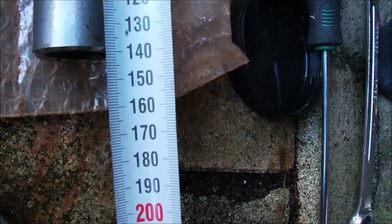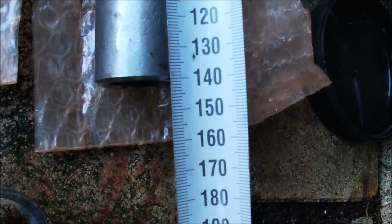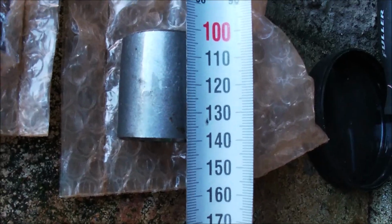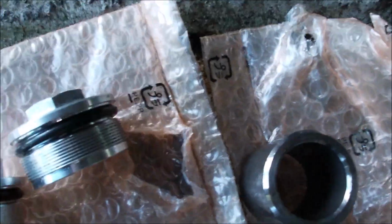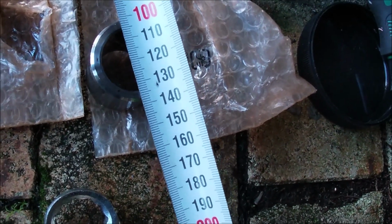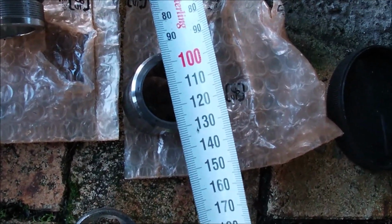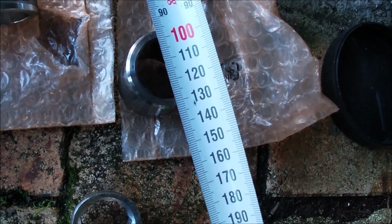You still put it back in, and if you don't want to buy these caps, you can just get another spacer and make it, let's say, longer. Let's say instead of 40 you make it 70 or 50–60. The size of the spacer externally is about 37 millimeters and internally about 27 millimeters. So it's a 5 mil steel. Some people manufacture spacers themselves. It's up to you. You can do it easily, or you can make several different ones and just swap them, but it's a bit fiddly when you ride anyway.